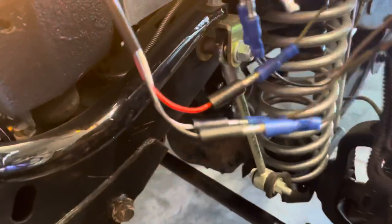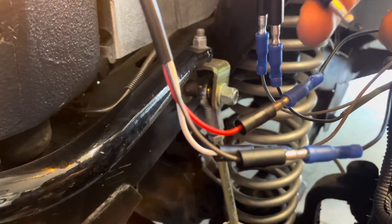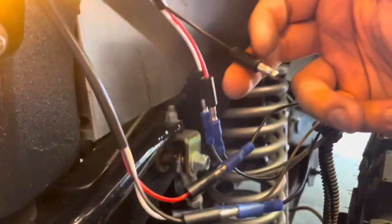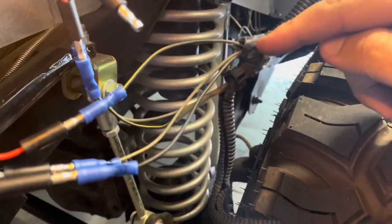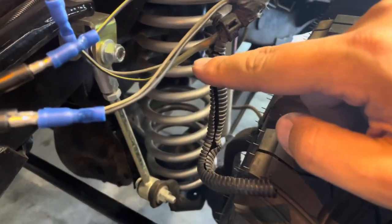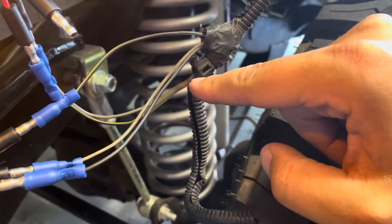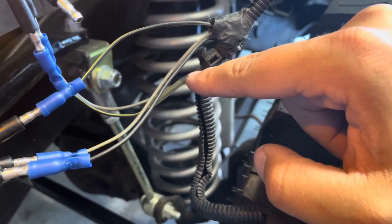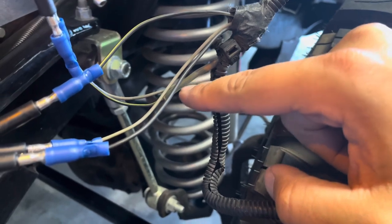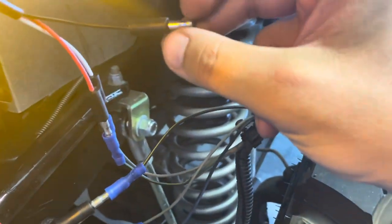The front one had three wires; the side one only has two wires, so I've got one here unconnected. I've got white ground connected and red blinker connected — this black wire I'm just going to tape up out of the way. Getting back into the stock wiring harness where it kind of V's off to the three and the two prong — this two-prong has that soldering where it takes the striped blinker wire and connects it with the striped blinker wire from the front bulb, so it's a combined running light and blinker wire.